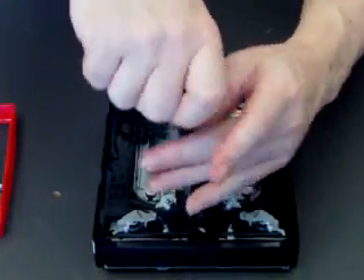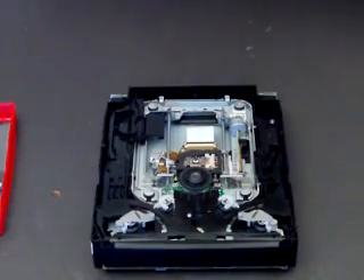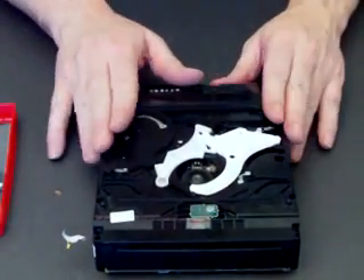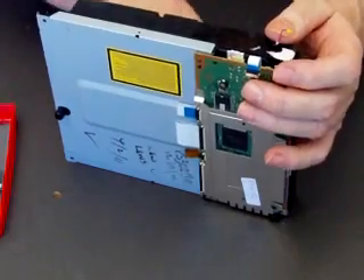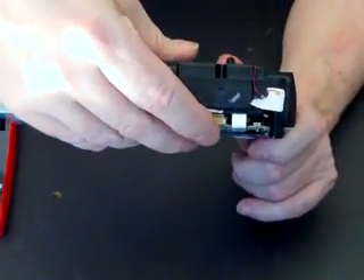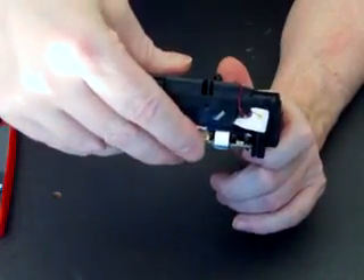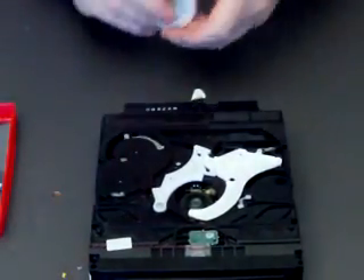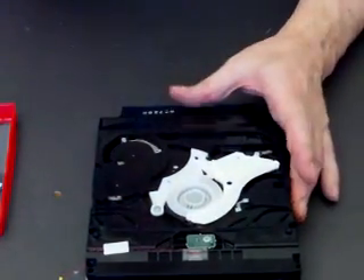Okay, I'll make a video later to show you how to reset that as well. Put the screw back in and that's it — we're good to go. Reset. Put it back together again. Top back on. Put the five screws back in. And reconnect your sensor into the little socket just there — it's very fiddly and very tricky. You'll need long fingernails or a pair of tweezers. It just goes back in the socket. And then before you put your lid back on, just remember to put your magnetic disc back in. So that's resetting the mechanism.